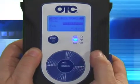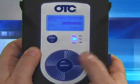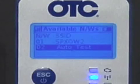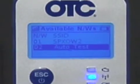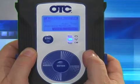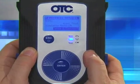Wireless Setup has two modes: Peer-to-Peer and Access Point. We will select Access Point. At this point, we want to view and connect to the available wireless internet connections. Hit enter to view. This is the internet connection we will be connecting to — yours should be listed here. Hit enter to connect to the wireless setting. It is verified.